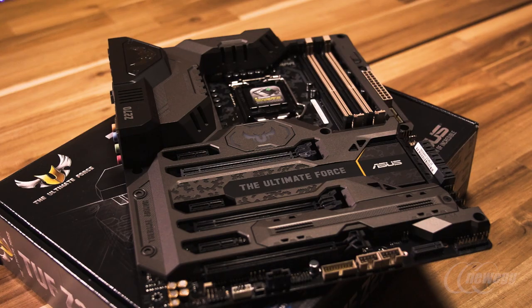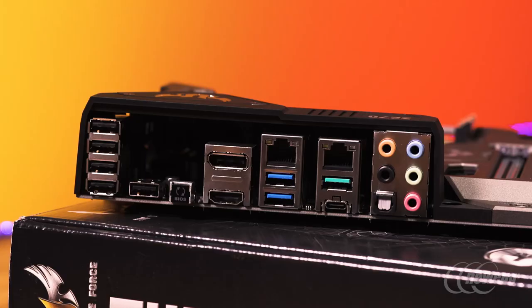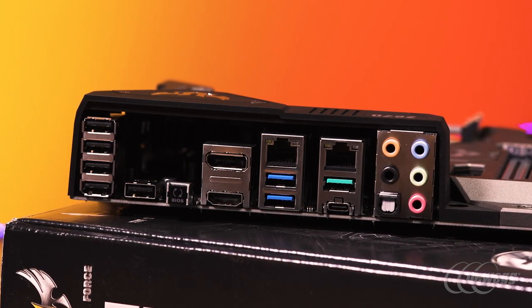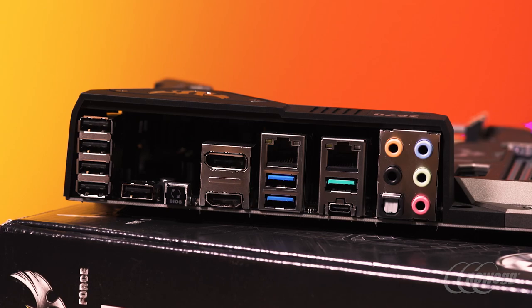So another interesting aspect that you're going to have on the Mark 1 is that it features dual Intel NICs. So the advantage is you can have one connection dedicated for essentially your outbound connections to the internet and another one for your local area connection. And you don't have to split the bandwidth of that port for non-intended purposes. So imagine if I'm sharing a big ISO image or raw data files, high bandwidth, high bitrate video, or I'm sending out my stream while I'm downloading something, that's the benefit of having a dual NIC configuration.